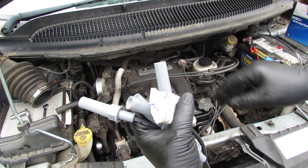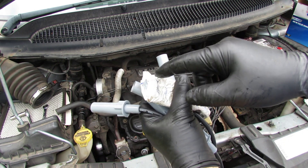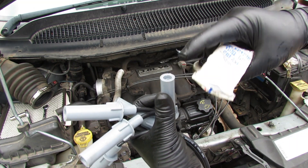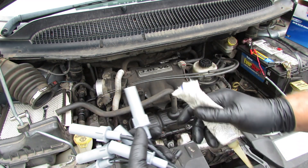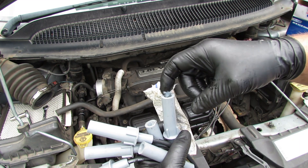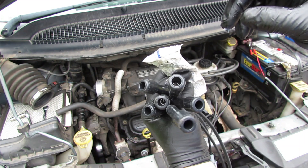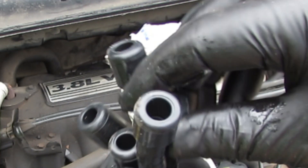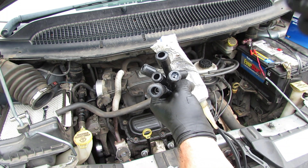The kit came with a little packet too, which works great, but that one's sealed up and the bottom blew out on mine — I've had it for years, might have stepped on it or rolled over it with the creeper. So I'm just going ahead and using this up. Over on the coil side, you can see these boots are dry too, which is fine since they give you the grease. I'll squeeze them and roll them around a little bit to get a nice coating in there.